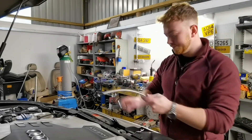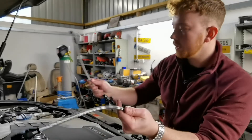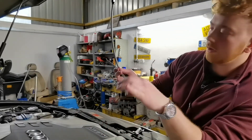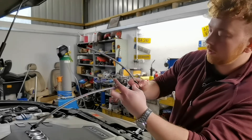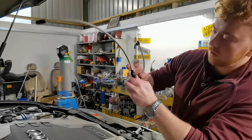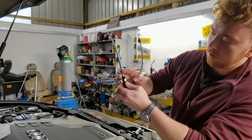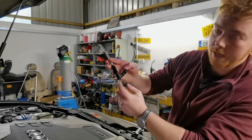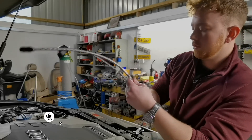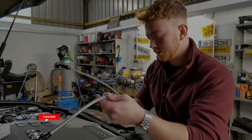So that's the two pipes made. That'll be going to one turbo, that's going to the other turbo. We've got a Y junction then, we screw it on to here like so, and then we have AN6 coming off this over to the oil filter housing. And that's it, thanks for watching.